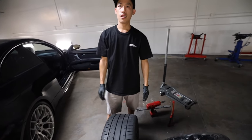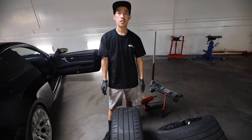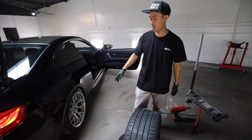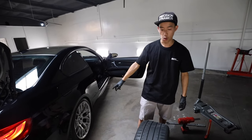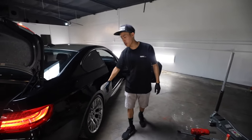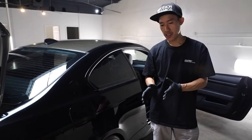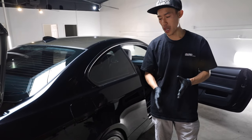So how do people figure that out if they've never bought wheels before? On this wheel — these are Competition CSLs, very similar — what we do is take off the original wheel, look at the size, the width, and the offset, then determine how much more you can go. But you also have to calculate for your tire size.